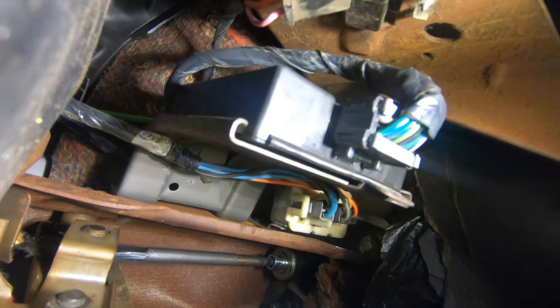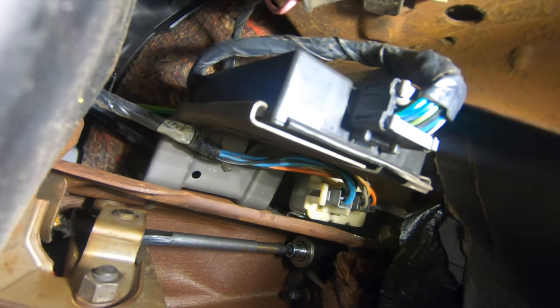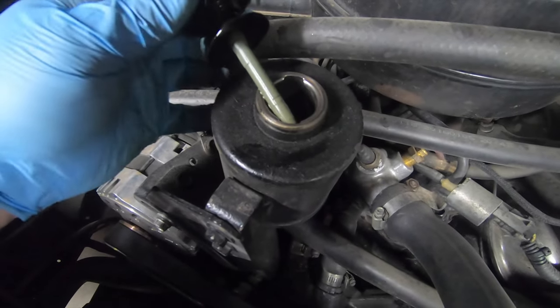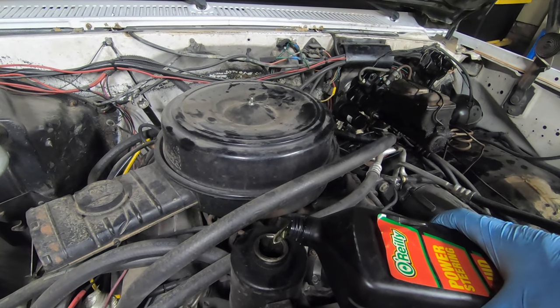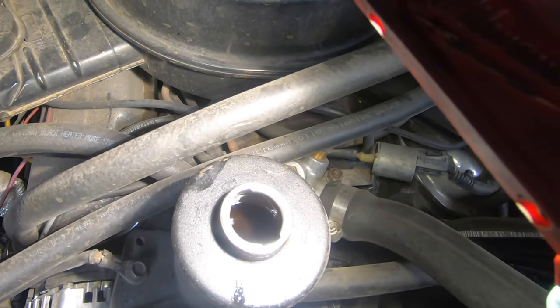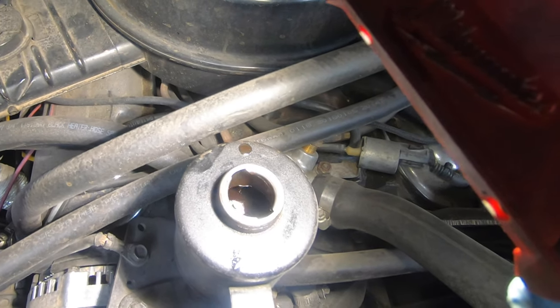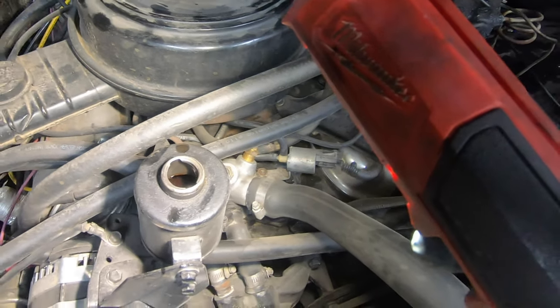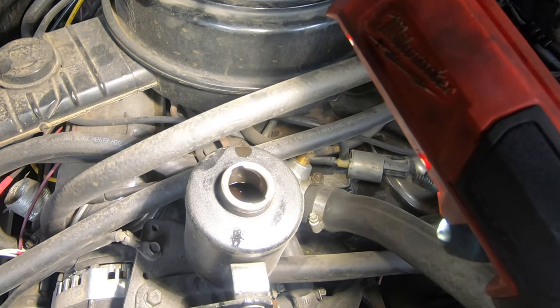I tested the brake lights. I just moved it forward and made sure the switch actuated and the wife verified that it is indeed working. So now we can go top up our reservoir and turn on the truck, make sure everything works. Turn the wheel all the way to the left and all the way to the right. Center it up, push the brake again. We topped off the reservoir and then I had my lovely assistant pump the brakes and turn the steering left to right. It sucked down some of that fluid. Now we're going to go take it for a test drive and make sure that everything's all good. We'll check the fluid one more time whenever we get back to verify that. Most importantly, not leaking yet.